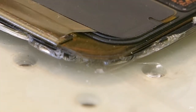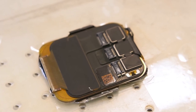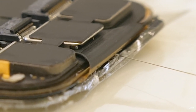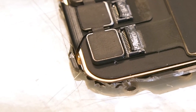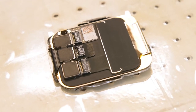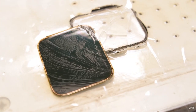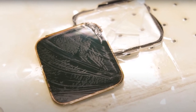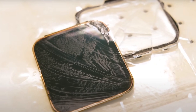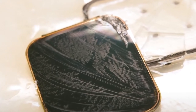That's the adhesive between the glass and the digitizer, and exactly where we want the wire to stay. It's like trying to separate the two halves of a very expensive Oreo, but if you break the cookie part — that's a good analogy. I'll lift the wire over the remaining curved glass chunks so it won't get caught on the edge or start cutting into the sensitive bits, and then gently keep sliding the wire through the warmed-up adhesive layer. The whole thing is heated to about 80 degrees Celsius right now, keeping the Oreo nice and soft for the wire to slide through. The suction of the machine keeps the watch screen from moving around too much while the wire slides through the adhesive. Once the wire finishes the cut and pops out the other side, the screen is loose and fully free to pull away from that top glass layer.